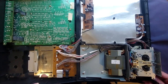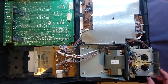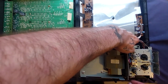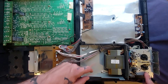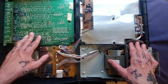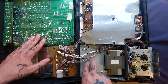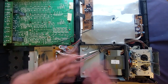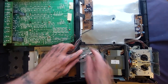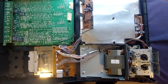The first thing I'll do is remove the cassette transport, since belt changes and things of that nature are the most likely thing you'll have to do. This is held in by two screws — I'm pointing at them now. They've both got ring connectors, which are basically connecting the chassis of the cassette player to common ground — it's sort of like drain, where the grey water in your electrical system goes. So bear in mind that these two corners are where these two cables will need to go back on reassembly.